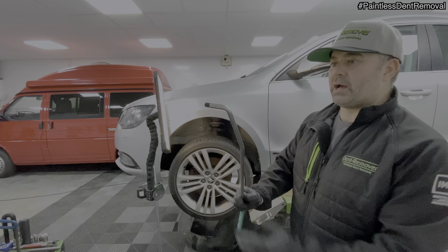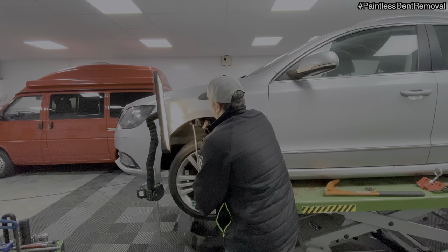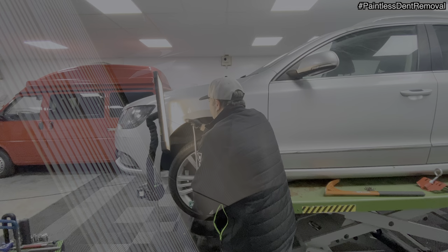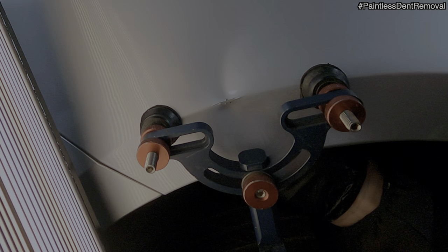To be honest, I'm not looking forward to this dent because the last one was so strong, especially with the paint being compromised on the body line. Again, I don't feel comfortable using the bar, so I've swapped to the fender pliers because these have so much torque and power and it's isolated within a small push area. Unlike the bar, which will lift up the full panel area, and that's what I don't need. Doing that could blow out the panel lip and give me more headache.